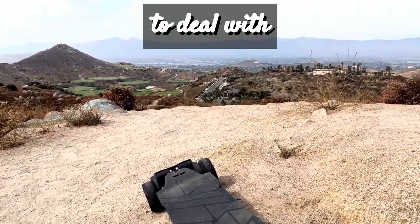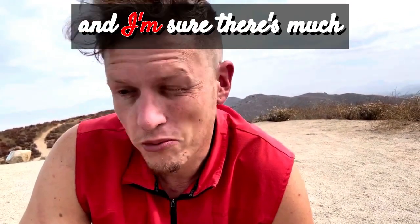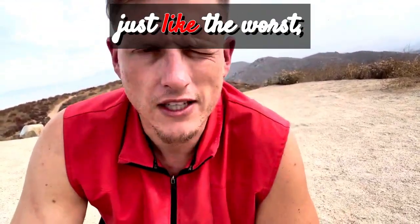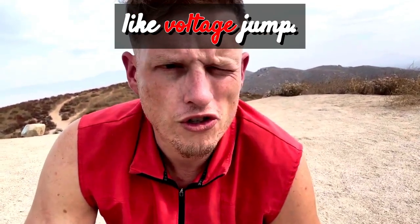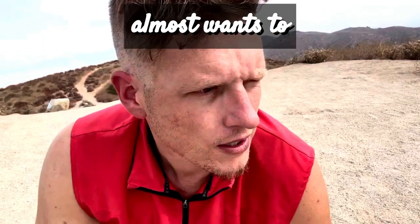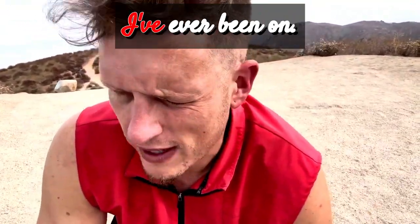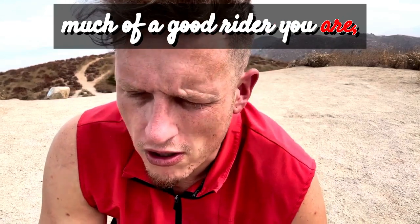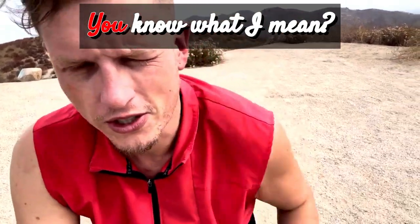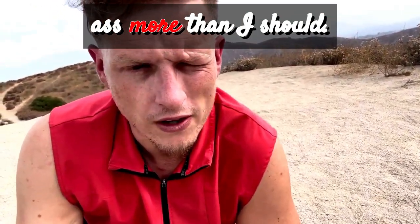You never have to worry about this with cloud wheels. If a really good belt drive board came on sale or was the only option, okay, I'd get it — I'm sure there are much better models than this, but this has been an abysmal experience. And this board has just the worst voltage jump — when you've just charged it and you inch the remote up, it almost wants to send you flying. You look like you don't know how to ride. This board does this way more than any other board I've been on, and no matter how good a rider you are, you can't avoid it because you're telling it to do something and it decides to do something else.